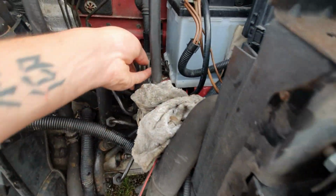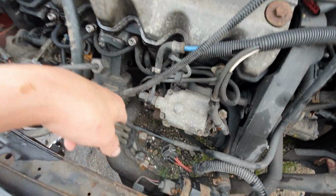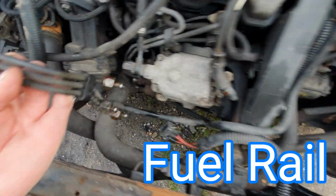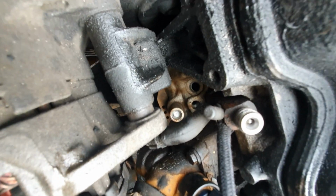So I removed the, I think it goes the other way around, yep, that piece of metal there goes on the injector pump, and removed the glow plug out of cylinder 1, which is right down in the depths of there. In fact, you can just see there, focus, just in there. That is how you can get to the top of the cylinder.